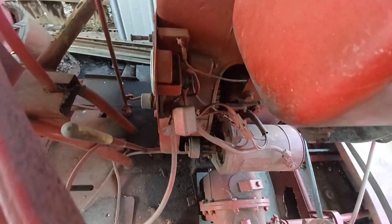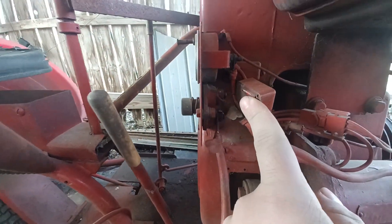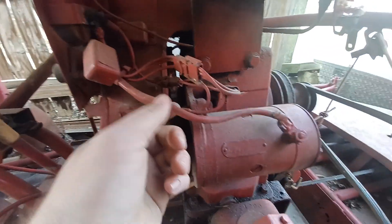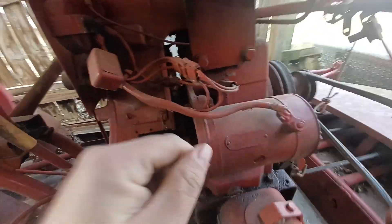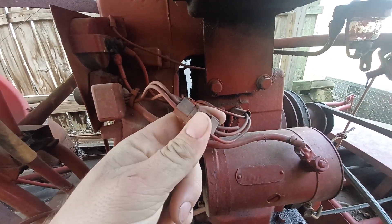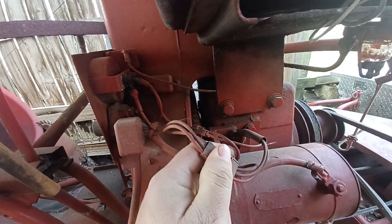Hopefully that tells you what you need. If there's anything else you need a quick look at — here's a quick look at the wiring. You've got a push button start there; one side goes off to your positive on your battery, the other one goes here to the starter. You've got a little clip here — you can't really tell what color the wires are, so that doesn't help you too much.